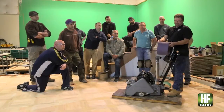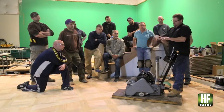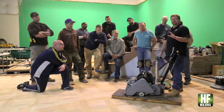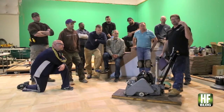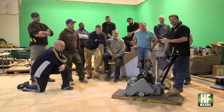This right here is pretty nice. You can see it's a little light on this inside edge. What I did before I took it off is I marked it so I know which way was inside or outside. We're cutting a little light here. Only way to fix that is what I call dress the machine. You got to be careful. Not all machines can be dressed. Some of them have a different shape, different configuration on their drum. Make sure your manufacturer lets you dress it flat. This particular manufacturer, I want it flat.